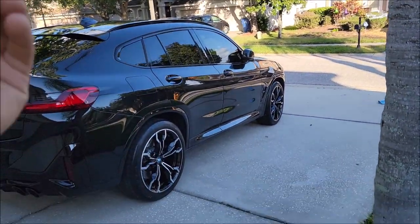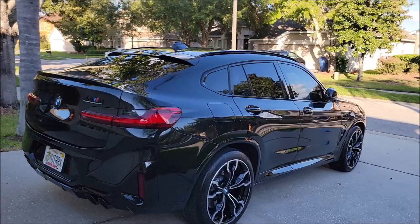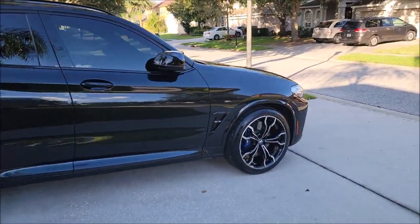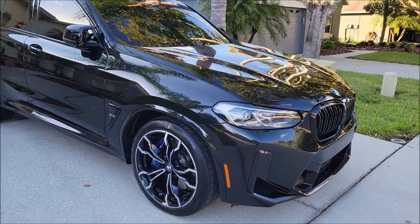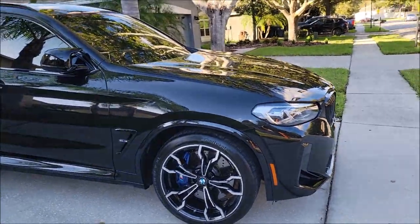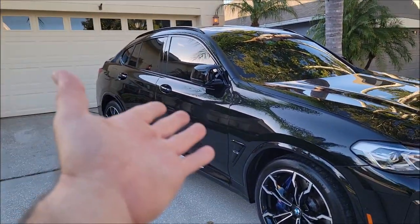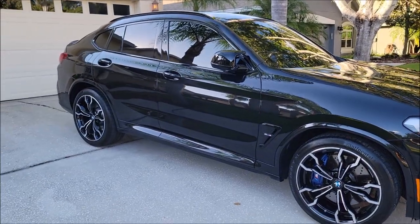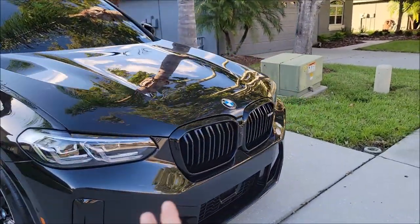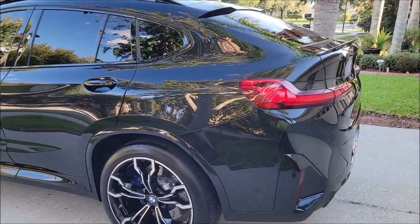I did a thorough real traditional wash, and that's what I prefer for this Infinity coating — mainly because any nooks and crannies that might have sand or dirt in them, like underneath the trim and in the door handles and lower portions, any dirt and debris that you don't rinse out is literally going to get caught in the coating, and that's not good. Yes, I'm working on a rinseless version of the prep shampoo, but I just prefer the traditional wash on this particular situation. I want you to spray out all those nooks and crannies to get all that debris out of there.